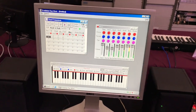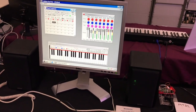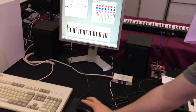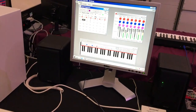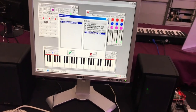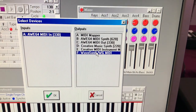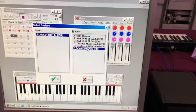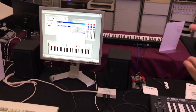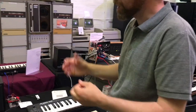So the Sound Blaster AWE32 introduced this hardware wavetable synthesizer, and the AWE64 had pretty much the same chip. But what Creative added with the AWE64 was the final option we have here, which is WaveSynth WG. What happens here is PCs are finally fast enough to do the sampling, the wavetable synthesis themselves. So you don't need hardware in your sound card. Right. The processor can do it.